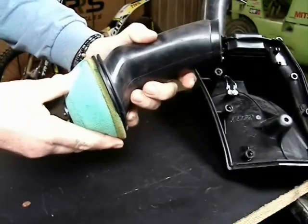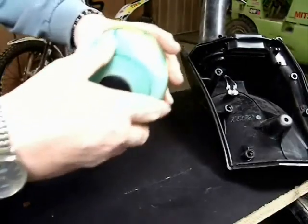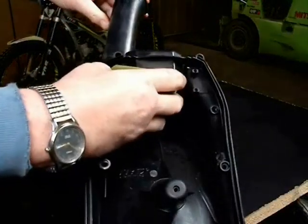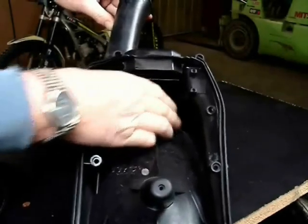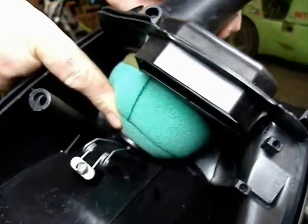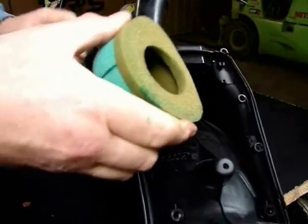It's rather easy to determine the oval shape and then just hold the filter in your hand, keeping the long side up and down — the longest part of the oval — and then you just slide it down in there, pulling back slightly on the spring. It falls over that sealing lip and you have a very good seal. But if it's rotated 90 degrees and the oval shape is not correctly aligned, you can have a poor seal of the filter against the interior of the box.